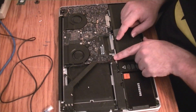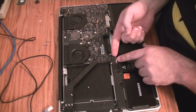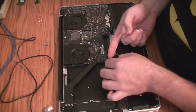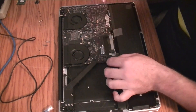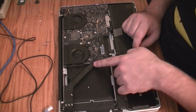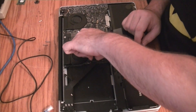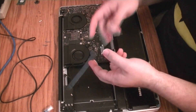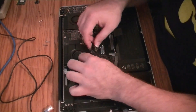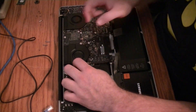This is the cable coming from the hard drive — lift straight up. Next one is the speaker setup over here — lift straight up. This is where the SATA would go; it doesn't have anything in there, this is where the optical drive would go — lift straight up. The wire coming from the antenna array is going to slide back that way, very gently.